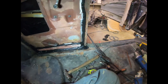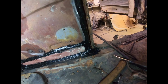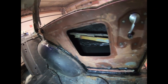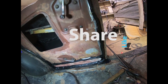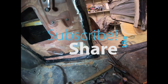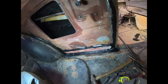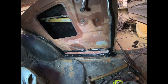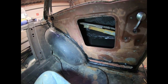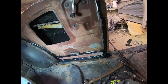There we have it — it's all in, done. Bottom piece tacked in with a little seam sealer. I know I went through this one pretty quick but it's the exact same as the other side so I didn't want to bore you. I'll peel the door hat off and give it a quick shot of black paint — calling it for tonight. Tomorrow I'll do a little bit of cleaning up, probably finish up the sill, put that little coat of fiberglass over the metal, and then I'm going to start working underneath the car, which is kind of ugly. I'm not really looking forward to that, but everything up top is done. I'll probably be under the car for a few days — see you guys later.